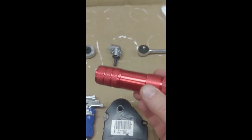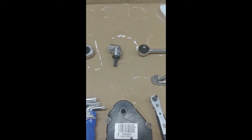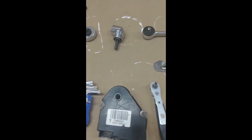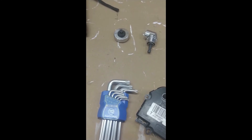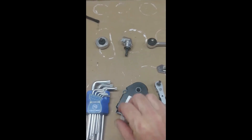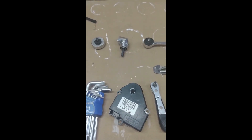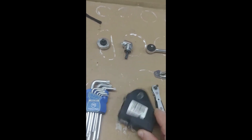Good luck! And some small flashlights — I ended up taping these into spots because you won't be able to shine it up in there with your hands in the way. Sometimes you're just going to be doing it by touch, especially for the top one that you can't see. Again, identify which one it is before you start trying to take them out — just disconnect them in place and wait for the thumping noise to stop. Once you've identified it, then you can go through the hassle. These blend doors are pretty generic, so they all seem to fit. Good luck!